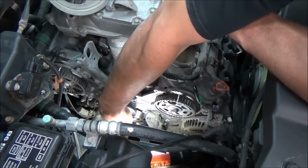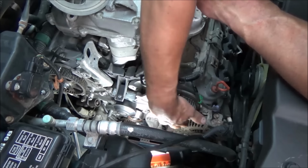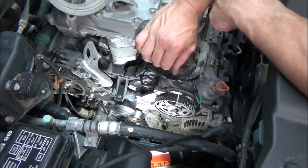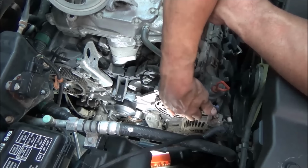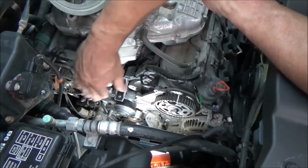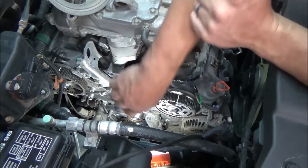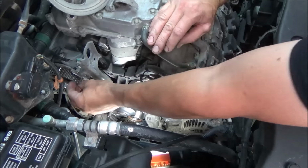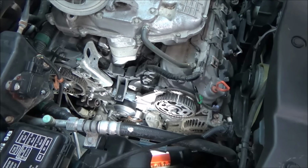We're going to go around the crankshaft and we're going to keep this side over here towards the front of the engine or left side of the engine, however you want to think about it. We got to keep this side of the belt very tight and we want all our slack to end up over there on the tensioner side. And typically if our cam sprockets were just like this one, they have no outer flange on them like they do on the rear sprocket, we could just leave all our pulleys in place, similar to what we do on a Subaru, and we just run our belt around and one-two barbecue. But that's not the case on this one because this pulley back here has the flange on it. If you're actually looking at one of these, you'll see what I'm saying.